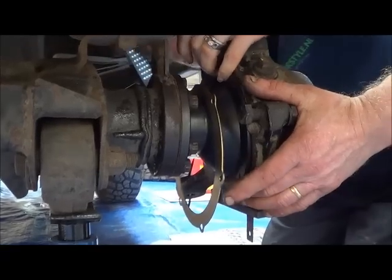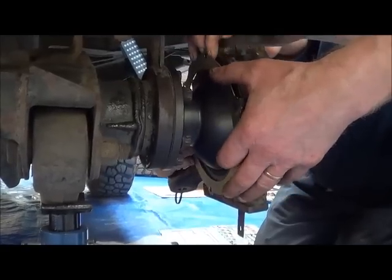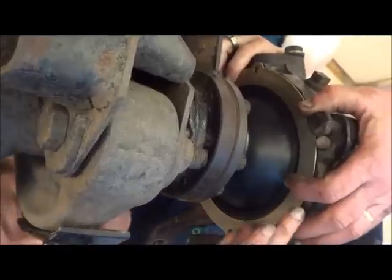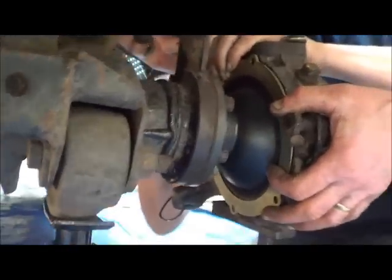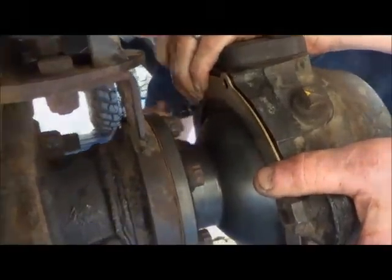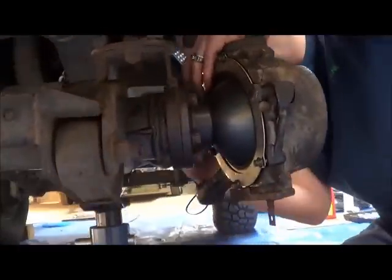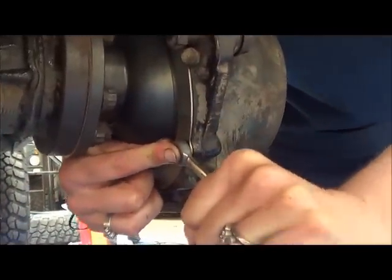So then you have to use that. And here's the retaining ring. And this is the other one here. So these are the two. So it should now line up nicely to there and there. It seems like they should line up. So I'll hold that. If you put one in one side and one in the other side. Down, and these are tightened evenly to 7 to 10 newton meters, which is basically hand tight. Yeah, that feels about right.